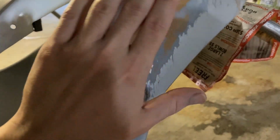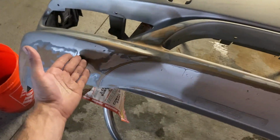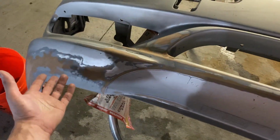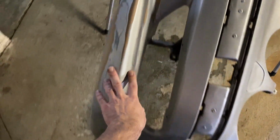It's going to make too deep of scratches on your bumper. In this case, the bumper had two deep scratches. You can see here that the bumper has been scratching the road too many times, and there are still deep scratches, but I can feel there's a deep scratch. I might have to go a little bit deeper with the sandpaper to make this flat and smooth. There were some other parts that were problematic, but basically that's it. A $2 kit of sandpapers from Home Depot or Harbor Freight, and some labor, and then you can have a sanded part.